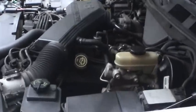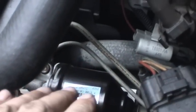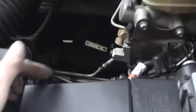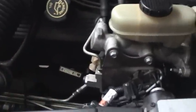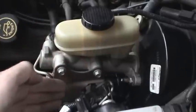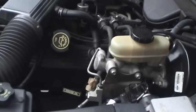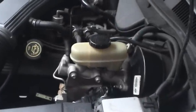I'm happy to report that the brake bleeding procedure worked out just fine — I did not have to have a special tool to energize the ABS hydraulic control module. I think the reason the method I used worked is because no part of the system was cracked open or replaced — no brake hose, no caliper, no master cylinder. So there really wasn't any opportunity for air to get into the system in the first place. The story might be different if I ever had to replace components — I might need to take it to a shop — but so far so good.